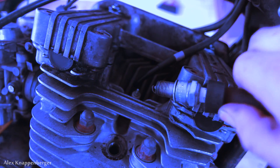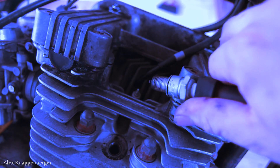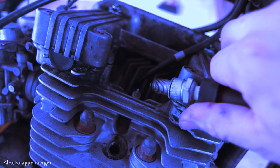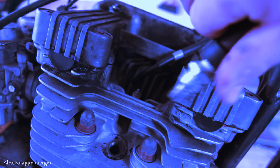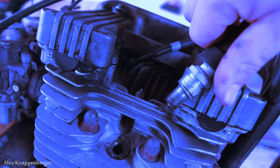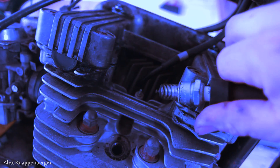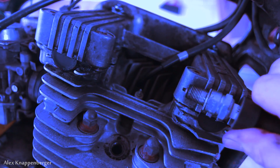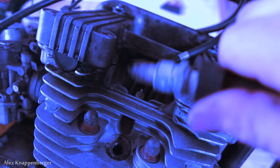Of course if you're not actually getting spark, you're going to want to trace it back to the root of the possible problem. On most small engines you're looking at possibly points — if you have something old with points on it, you want to look at those — or CDI ignition, where you're going to look at the pickup coils and the igniter box. If you're looking on a car, you're going to be looking at the distributor, coil packs, and so on depending on whatever you're looking at. You want to trace it back to the root of the problem and make sure your coils are getting power to them. First of all, make sure it's not some type of wiring issue.